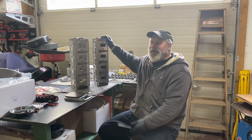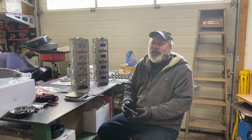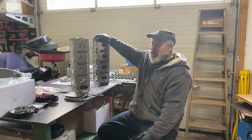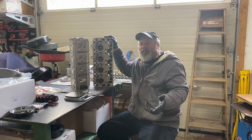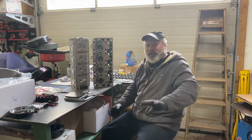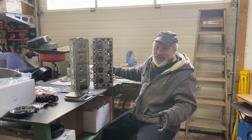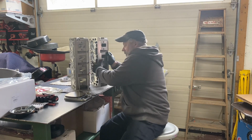What makes these valves unusual is that these heads didn't exist in my world yet, very expensive. I was trying to low buck a set, so offshore castings with good hardware is pretty common right now in the marketplace. There's no shame in having the offshore casting because it's actually pretty decent. Your only concern is the machine work, and as long as the valve guides don't fall out, which doesn't seem to be very prevalent, it's just a hunk of aluminum. Yes, there could be cracks and porosity, but it looks pretty nice, so you've got to believe they're doing something right. A lot of companies are selling offshore castings with American-made machining and hardware.